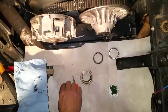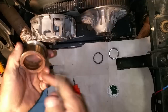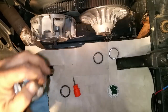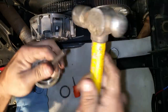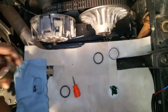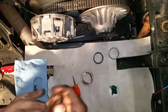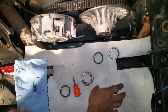For those not replacing their bearings and just wanting to do the service, the bearing comes out on the opposite side — there's nothing holding it in, it's just pressed in. Take a punch, tap it, move to the other side after a couple hits and it'll pop right out. This bearing actually feels like it's got dirt in it, so on a normal day I would throw it away, but for the video we're going to go ahead and grease it.